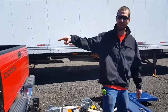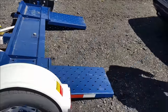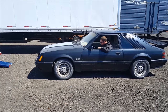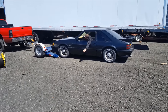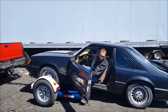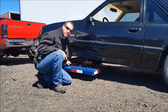Now we're ready to load our vehicle on. Make sure you set the parking brake on the towed vehicle first. Go ahead down here, pop this cotter pin out. Take this pin out here and make sure to set it somewhere safe — you can see this deck drop down now. If you're not comfortable pulling the vehicle on yourself, make sure you have somebody up there to spot you, especially if it's an excessively wide or skinny vehicle so you don't damage your vehicle or the trailer. One thing to note: if you put in a vehicle that has a low front bumper, you're going to have to put some blocks of wood under here, otherwise when you pull it on you're going to catch the lower valance and screw some things up.